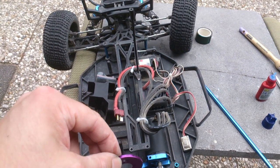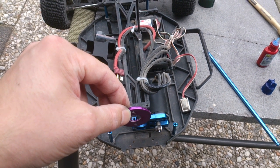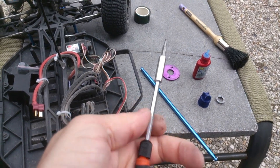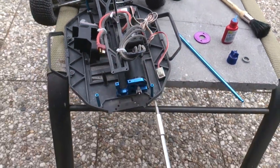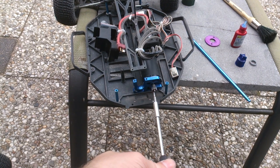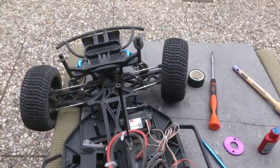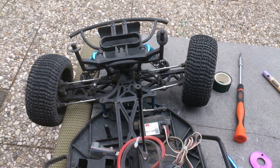I'm not very fond of this design. Adjusting the motor and the gear mesh to get it to mesh properly is a disaster, because if the rear clip is on you need something long — I use a very thin screwdriver extended with a hex bit to go through the rear suspension and just barely reach the motor screws. It's not terribly convenient, and because they're mounted entirely to the left, they're basically in a heap of trouble. To remove the central drive shaft, the easiest thing I've found is removing the front two screws and bending the front somewhat out.